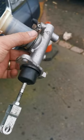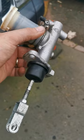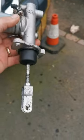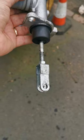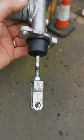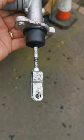I got it off eBay for £35 including the actual slave cylinder — it goes onto the gearbox. So look on eBay, save yourself getting ripped off. It's not a bad thing. Basically, measure the distance from the pin hole there, which goes into the pedal, to the base with a vernier so you get it exactly right.